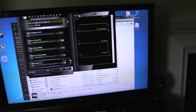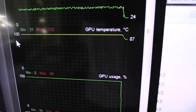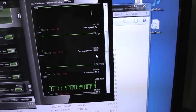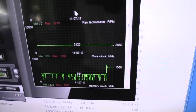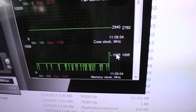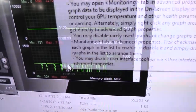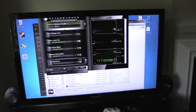You can see the GPU temperatures are pinned at about 100 and 101 degrees. If we scroll down, fan speed is pinned at 80%, which is the maximum it'll do. And then the core clock, which should be at around one gigahertz plus, is instead hovering between 581 megahertz and even dipping as low as 191 megahertz. So this system is thermal throttling and there's something we need to do about it.